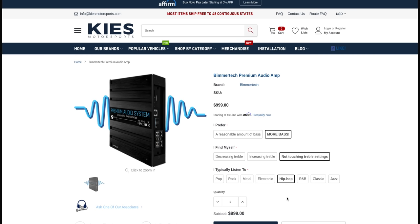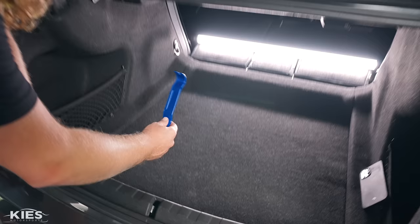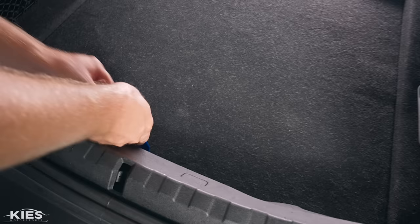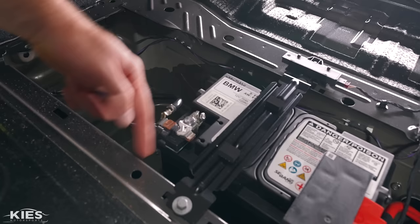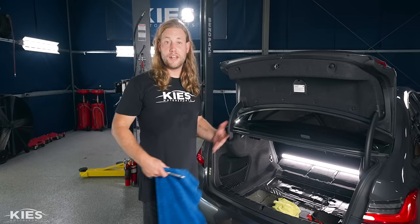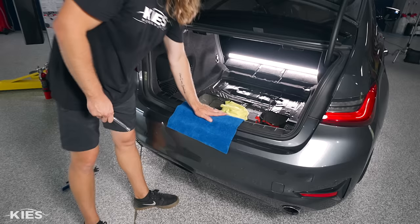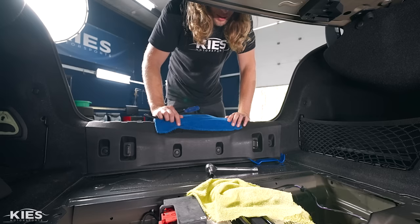Let's walk through the installation process. First thing you need to do is disconnect the negative terminal of your battery — it's under a piece in the trunk and the best way is to use a trim tool. Loop it under, pull it up, and slide the cover completely out of the way. Then take the negative terminal off with a 10mm and push it to the side. You won't have to reset anything besides your radio stations. Whenever your battery is disconnected, never shut your trunk because it's electronic — use a microfiber towel to block it. Also fold your rear seats down as a backup plan.